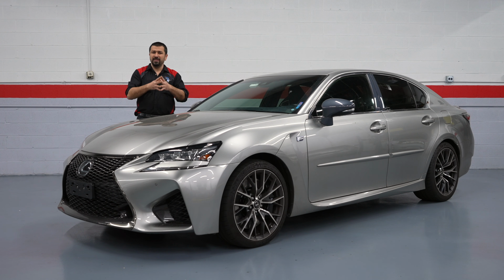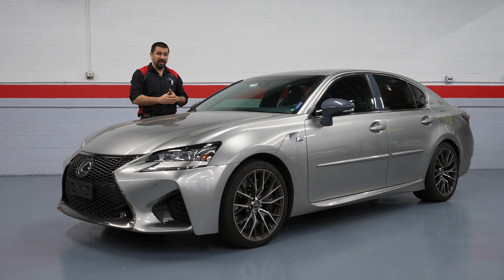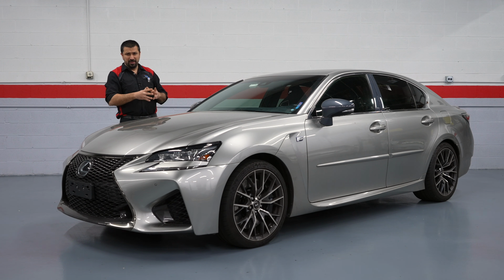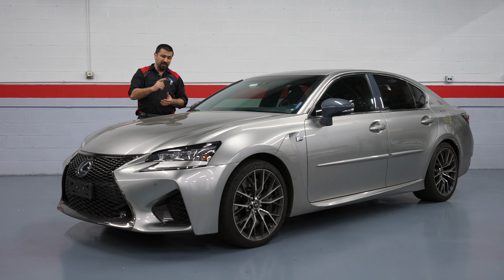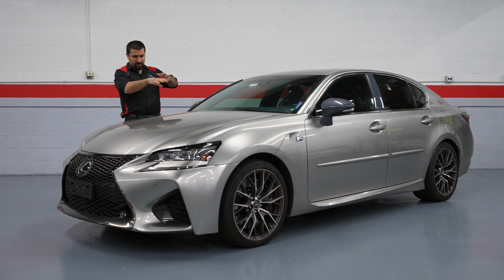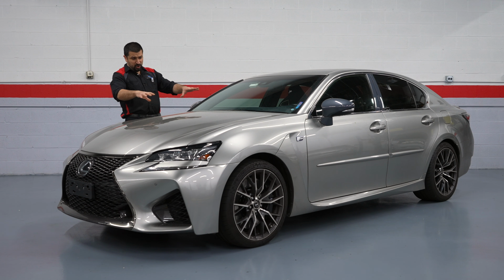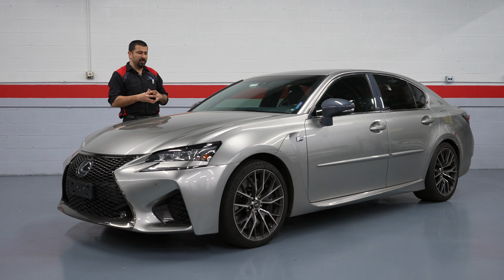You get into a car like this, your mentality should be, this is going to be an expensive car to maintain, but it is well made and it's reliable. The other thing is this engine is super reliable. However, don't maintain it, and this thing will start burning oil like you would not believe. And the other thing is, there's one common oil coolant leak from this engine, from the valley plate underneath, from the heat exchanger right underneath the intake manifold, very expensive, and when they leak, they just start bellowing coolant out. And that is really one of the common problems with these.